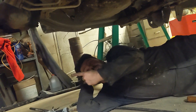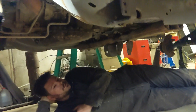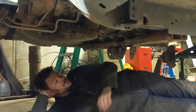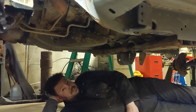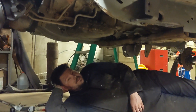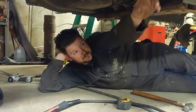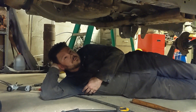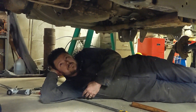I just have to move this one and then we can try it. So we're pretty close to building some mock-up links and flexing it to see how things work. This is all a test - nothing's plated, obviously. But we've got to see where the links fall just to see where we can get suspension and tire placement. With the upper on the outside like that, it's going to get really close to the tire. It's like fitting 10-pound stuff in a 5-pound sack.